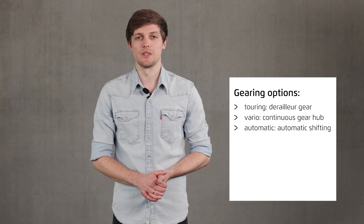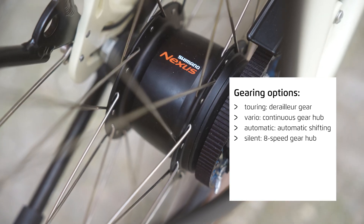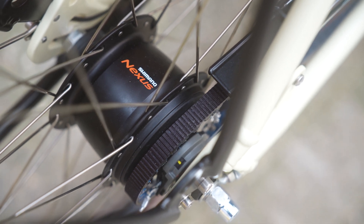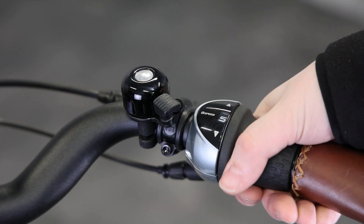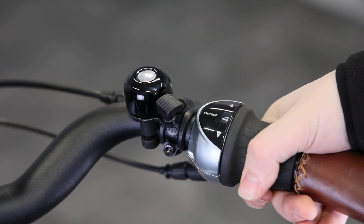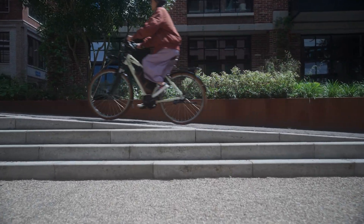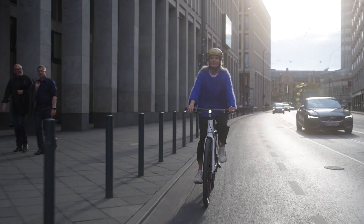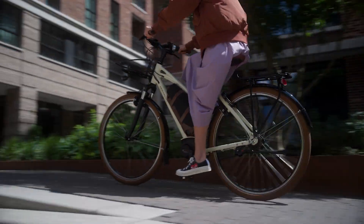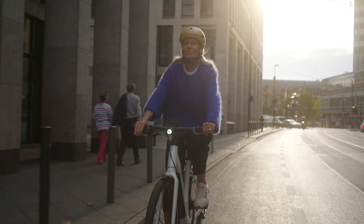The next gear hub is called Silent. Under this term we summarize the Shimano Alfine or Nexus 8-speed and the Nexus Inter 5 gear hub. With these variants you can shift smoothly and silently via a twist grip or gear shifter on the handlebars. As with all gear hubs, you can also shift when stationary. You should not shift gears under full load while riding, but a brief moment when you take the power off the pedal is enough. Compared to the two Enviolo options, the Shimano gear hub is slightly lighter and more efficient, with lower power loss. This gear hub is also best suited to city conditions.